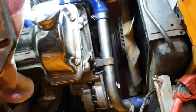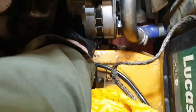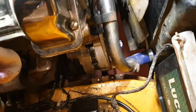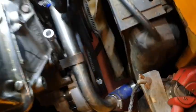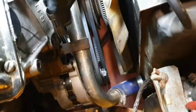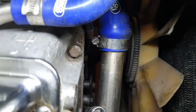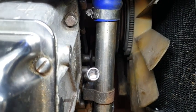Okay, a little tip that I've just discovered, because of course, trying to keep tension here with your hand there, do up the bolt just there, nigh on impossible. So, get a little bar here, pop it down between these two points here, all of a sudden it holds that really nice, good tension on the belt, and it means that I've now got hands free to be able to do up that bolt, that second one away, and I can put extra tension on if I want to, because I've got the bar in place. Can't beat a bit of leverage.